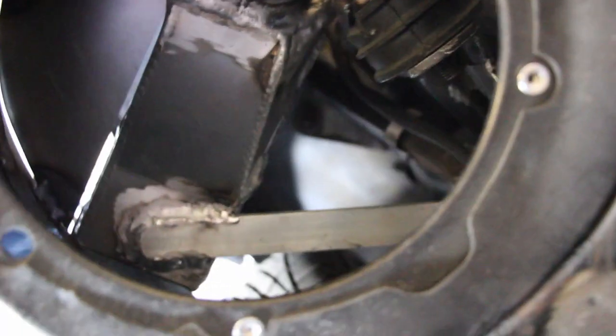But yeah, just a little bit of Techno I'll put across there. Some acrylic or some old mud flaps I'll just cut up. Got to do the same with the fresh air feed anyway. So that's cool. So we're going to let all that cool down. We'll quickly give it a wire wheel under there, maybe a little grind up on some of the welds, and then we'll seam seal that along with seam sealing the flitch panels.